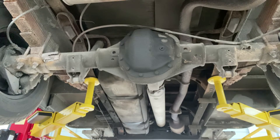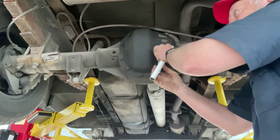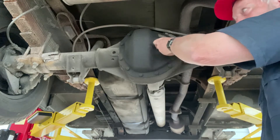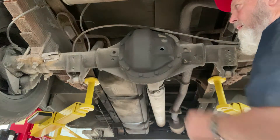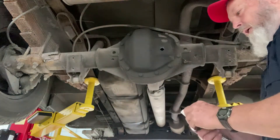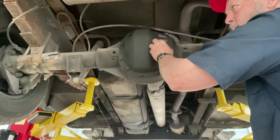The wind's been blowing leaves in here all winter. It's been a while since I swept them up. Let me go grab a tool and see how tight this sucker is. I think I may have only had this plug out one time — I had a leaky wheel seal years ago and might have put some oil in it then. It ain't low. I was able to touch it with my pinky. The magnet looks good, nothing on the magnet. I don't know what all that growl is all about.